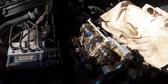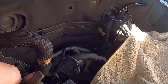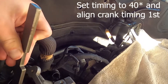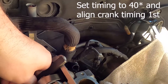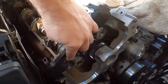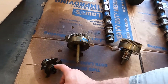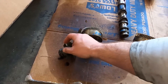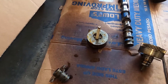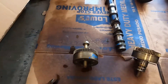M156 timing - this is the right side exhaust and intake. This tool will slide in the back side into these slots in the cams. You can see already how much more each one needs to turn. Once we get this locked in, we're going to use this tool to set it up and lock it on here as well. This is our exhaust cam adjuster - this is what the sensors actually read as a reference for cam position. These are oil-controlled, so oil actually comes up through the cover, and this is how you get your adjustments to advance or retard your timing ever so slightly.